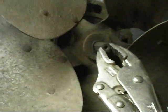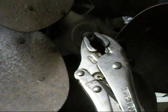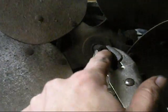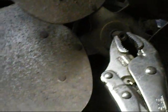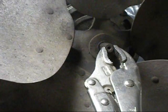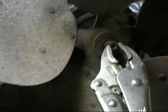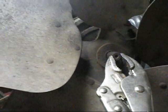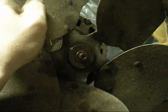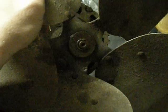The easiest way to get blades off — been on there for up to 60 years — get a pair of vise grips or something without damaging the shaft. Lock them on and try and twist it off. I already broke it before. I've put the camera down and used both hands for this. If it don't come off, get someone to control the fan motor for you. Slowly.